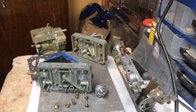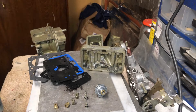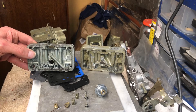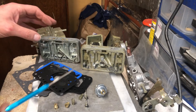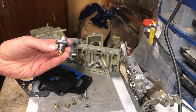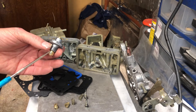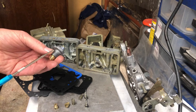Let's have a look - I'm going to put them side by side. This is the metering block of a Holley 4180, and this is the standard 4160 metering block. As you can see there are already some differences between the jets: on this one they go in straight, on this one they go in through the side. So that's a dead giveaway that it is a 4180. The other difference is that because 4180s tend to be used on trucks, they have what Holley calls a dual-stage power valve, meaning the valve opens partially at one vacuum reading and then fully at another.